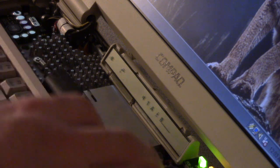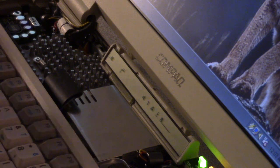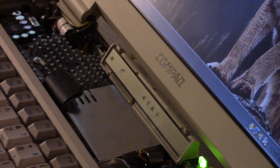Yeah, so we've got a few power status icons out, but disk seek and hard drive seek are both back in the chain gang. Let's put the floppy drive back in. Okay. Why don't we shut her down again? I'm going to do another power on test.